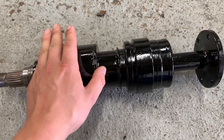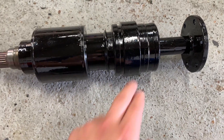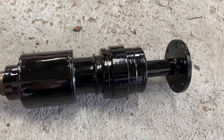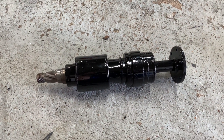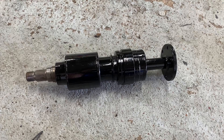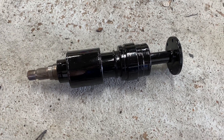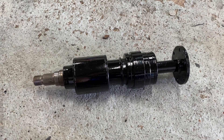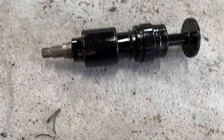Underneath that is the area we need to get welded, which will basically lock the freewheel mechanism to the viscous coupler so it won't fail internally anymore. We'll also probably drill a little hole to drain the oil out. I had it all put together, but there's no reason not to do this because I know it's going to break — probably at pretty low power in the lower gears. So let's just do it now.